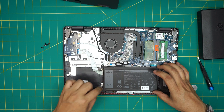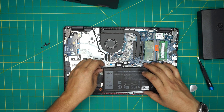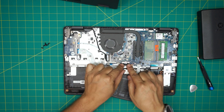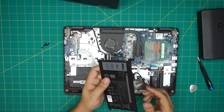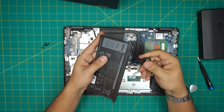Once the three screws are removed, pick up the battery and release it from the corner — pull it forward a little bit and it will release itself. For the battery contact, put your fingernails at the sides and pull it back evenly, and it will release the contact. You can also disconnect the jack just by pulling it backward.